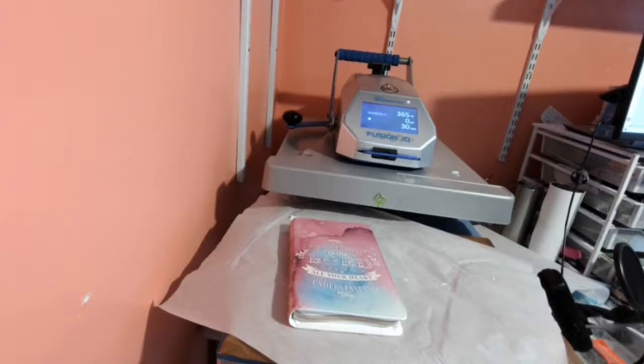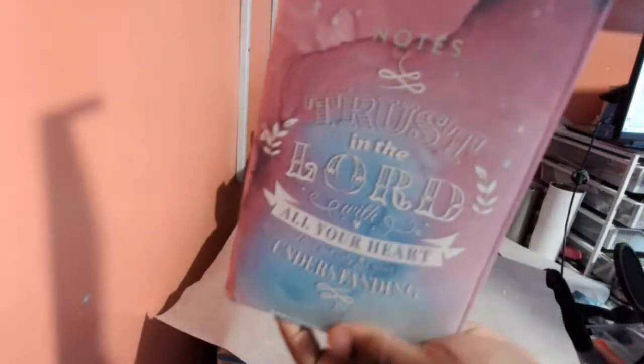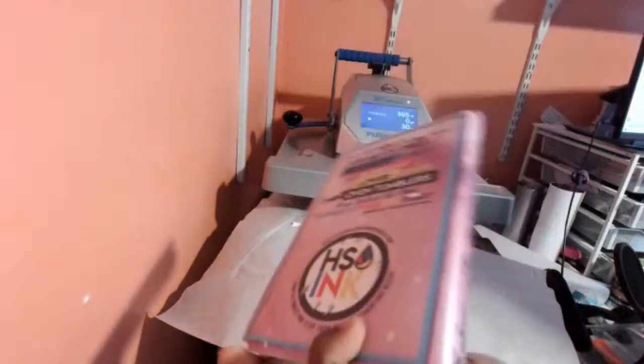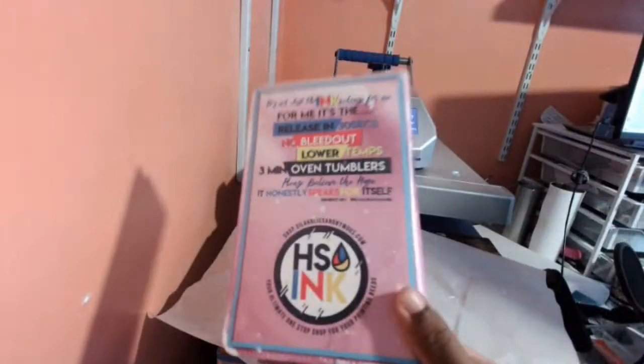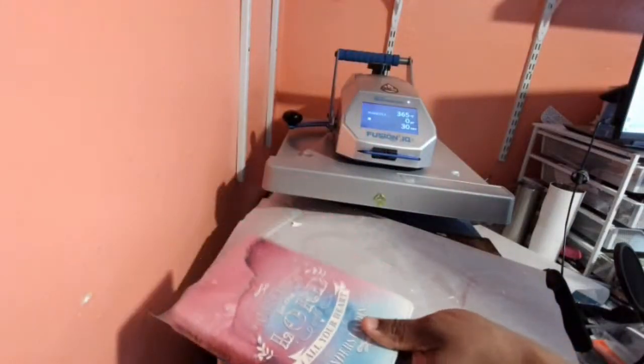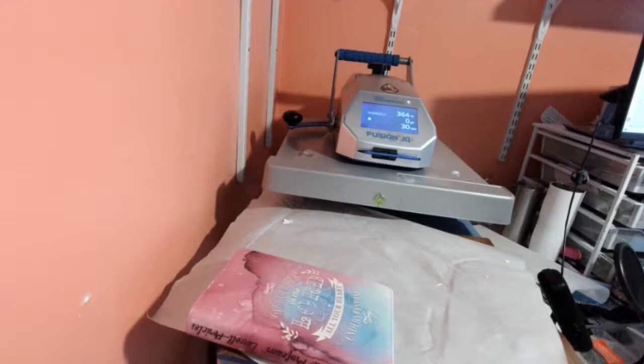Other companies will tell you to use premium presentation paper matte. This was printed on plain paper setting. Do you see how those colors look? There is no color loss with this. It is not going to be less vibrant. This is printed with plain paper, bright white quality setting. So if you're experiencing smearing, it's probably because you went by the ink vendor's recommendations and used premium presentation paper matte or any of those settings. The way that our paper is made, it does not require all of that ink. It is going to release just using plain paper setting, and you're going to get full color saturation with those settings.